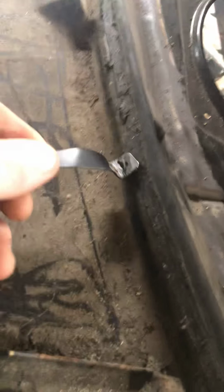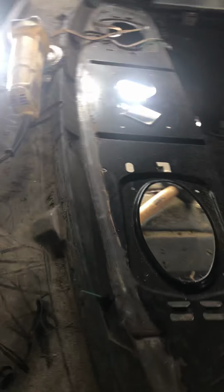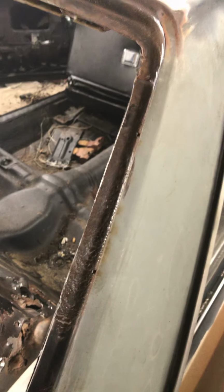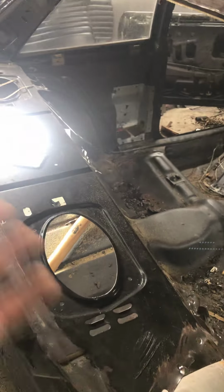And I mean, it took me 4 or 5 times, and the same thing on the bottom. I was able to get it up under there and just, you know, move it along. And the bottom wasn't too bad. Once I got the bottom loose, and like I said, I had already cut the sides out with the wire pretty much all the way down on each side, and I got that bottom worked out, I was able to kind of pry it up and get the window out.